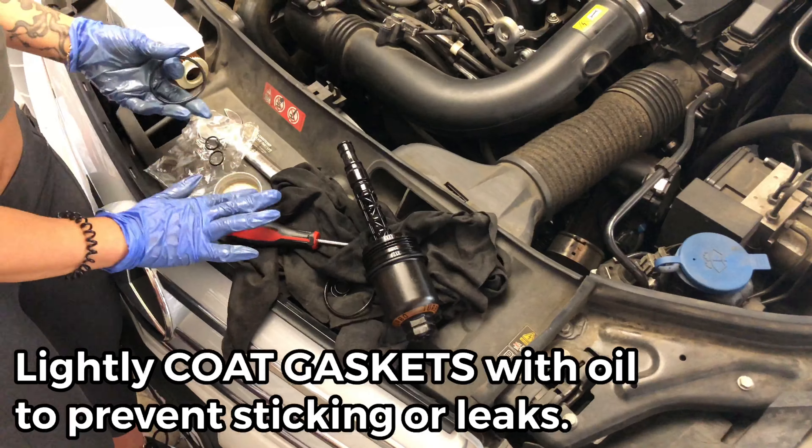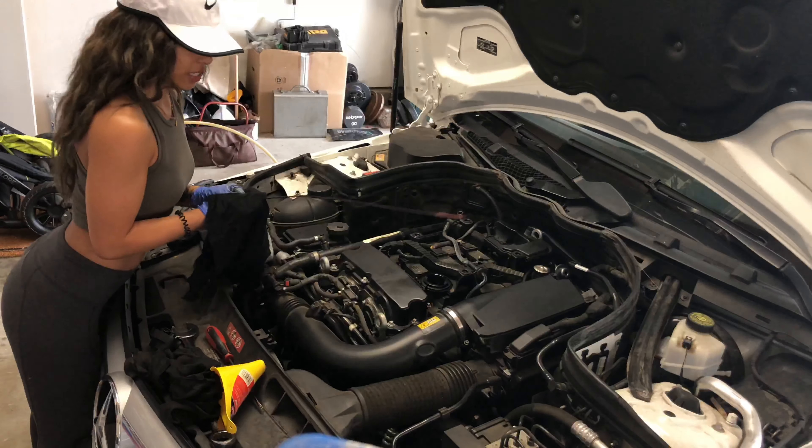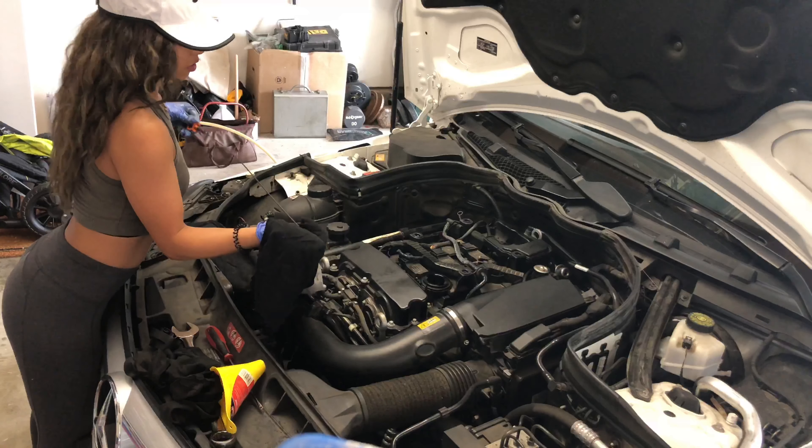There's the oil filter. We're going to put this all the way in. You should see the oil will all move with it. Make sure that the oil is still warm because it'll be easier for the oil to transfer into the extractor. The reason for why we're doing it this way is because that's just how it's done in most other dealerships.